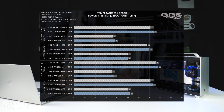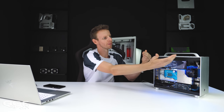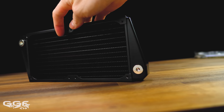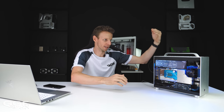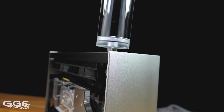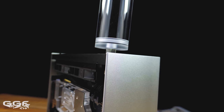Personally I've just been leaving the side panels off - I think it's easier, it's better to see inside, and it makes it a little bit lighter. I live in a pretty good dust-free environment so I don't really have to worry about dust in the system. Moving on to filling the system - it was very, very easy because the radiator used is the Xflow or Crossflow, which has ports on both the bottom diagonal and the top. So I could simply screw in a cylinder reservoir up there, fill it up with coolant, rock the system about, and let it drain directly in. With a normal traditional radiator you wouldn't have these top ports and you'd have to try and add a T-piece or something to fill it somewhere else.